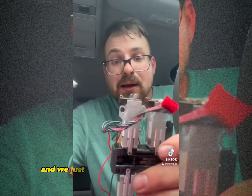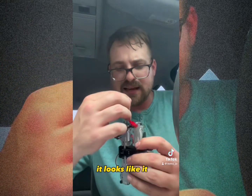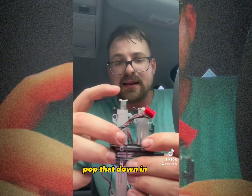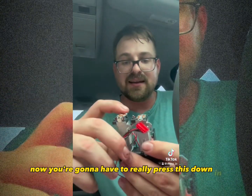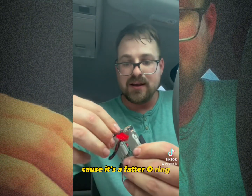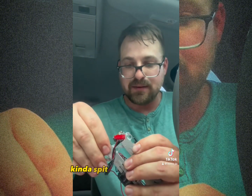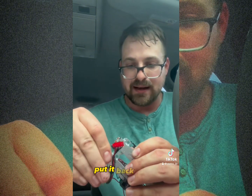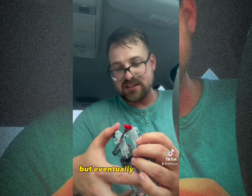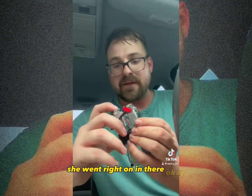And we just pop this right back down in there. Make sure my spring and everything's in there. It looks like it is. Pop that down in there. Now you're going to have to really press this down in because it will not want to go, because it's a fatter O-ring. So you might have to kind of twist it a little bit, pick it up, pick it back, put it back down. But eventually she'll go. Just like that. She went right on in there, okay?